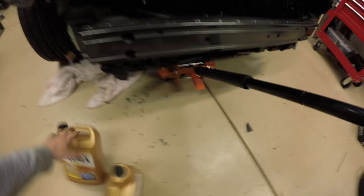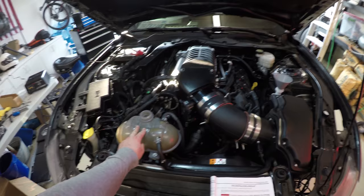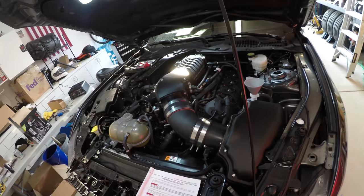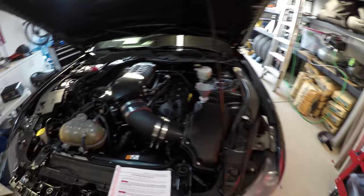Now to add coolant. Make sure your petcock is tightened. Okay, just a little recap. Again, we've got all of our wiring finished, zip tied. Filled this tank, radiator tank with fluid. And then we filled up the intercooler tank with fluid as well. I do not have a coolant air bubble flushing system, so I'm just going to follow the instructions on basically doing a little dance with turning the ignition on, letting the pumps cycle, and then topping off the levels.